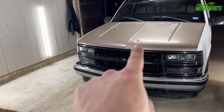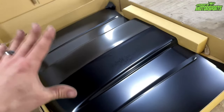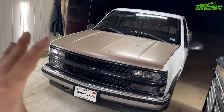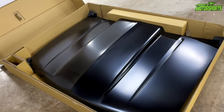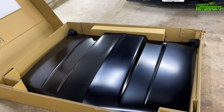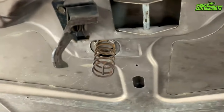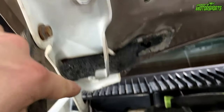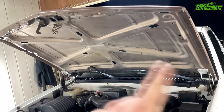My wife's going to come out. We're going to swap — take this hood out, take all the pieces off I need to transfer over, and then we'll get this in. This will be sanded and primed in the future, just like the rest of the truck, and then we're going to be doing a purple metallic flake bed liner over the whole thing. It's going to look beautiful. I know bed liner — not everybody likes the bed liner, but I personally do. Just trust the process. We'll get that hood off and get this bad boy on. We will have to switch the spring over. One right here and one down there on both sides — two 13 millimeters takes this off.